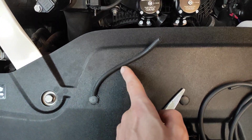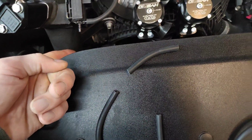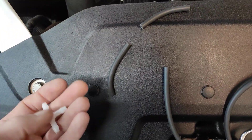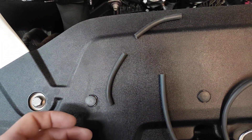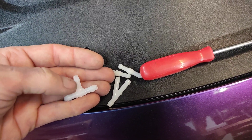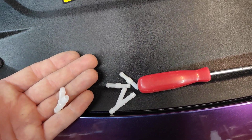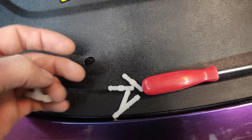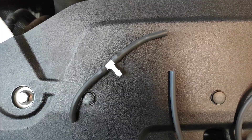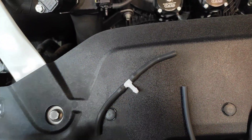You're going to take the line off and cut it. I chose to cut mine in the center because it works for the routing height — I'm running my line backwards underneath. Some kits include fittings and some do not; you can look up boost gauge hose kits on Amazon. Some will include a plethora of different fittings: a T, a Y — the only difference between a T and a Y is if you have a more specific route and don't want a perfect 90-degree angle — and also some unions. We're going to use a T.